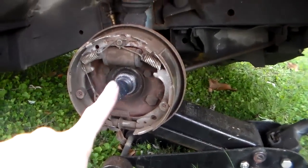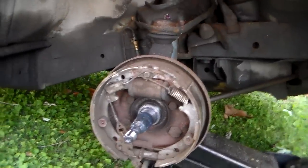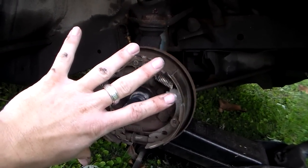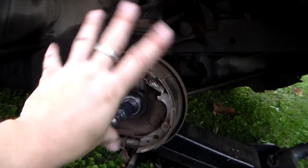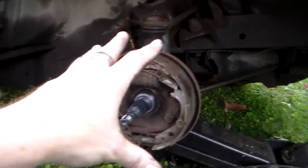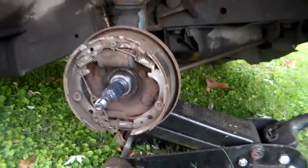But I noticed something immediately fishy about the suspect side. It would slow down and stop, and it seemed like it was stopping pretty quick. But when I came back out and my foot was off the brake, the wheel was still dragging a little bit — it didn't want to spin freely, just made about a turn and stopped. That's not supposed to happen. When you let off the brakes, the wheel is supposed to turn freely again. That raised a red flag right then.